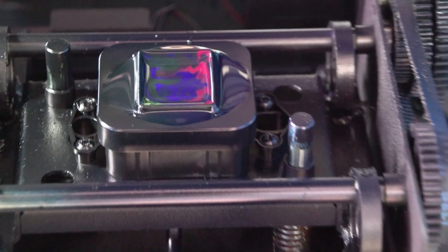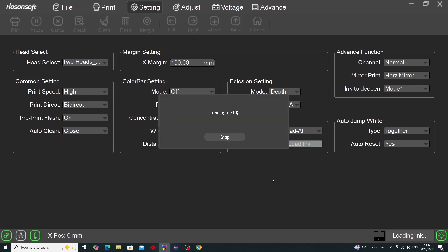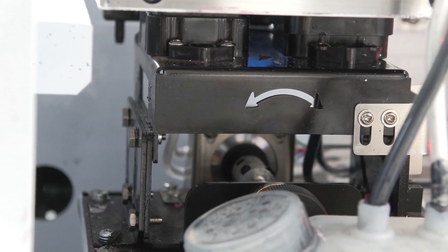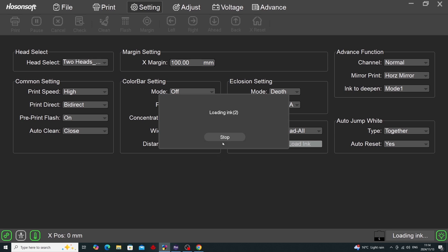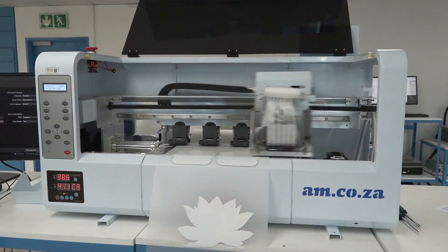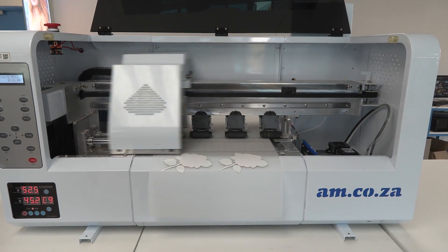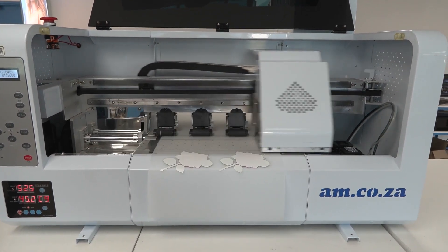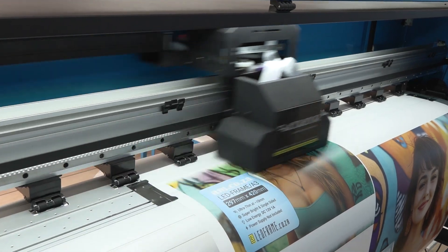On Print EXP systems, go to Settings, then Load Ink. You may choose to only load ink from a certain print head if your issue is limited. On the machine you should see the head capping and the pump starting to work. You should see ink flowing through the tubes. Press Stop, then move the head away and visually inspect the caps — they should clearly have ink in them. If ink is flowing freely and there is ink in the cap, do an auto clean and you're good to go.